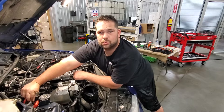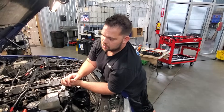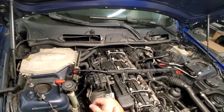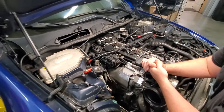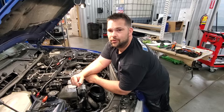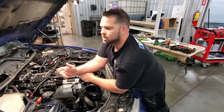You should replace that hose as soon as possible, because what happens is it will dry rot and blow a hole in it. Sometimes it'll burn up and ruin the sensor. Sometimes it'll melt your vacuum reservoir. Between those two problems — the EGT sensor wiring and this hose — that answers pretty much any code you have for exhaust gas codes coming up on your car.